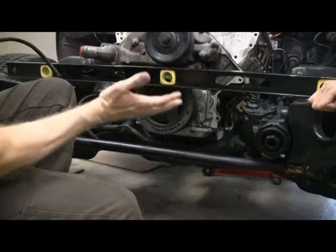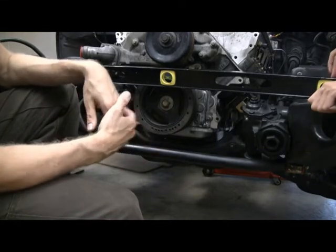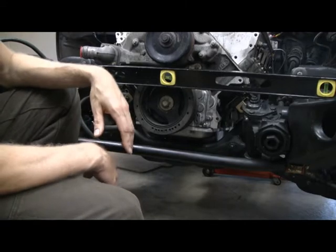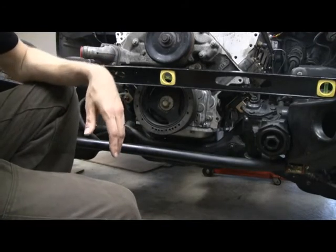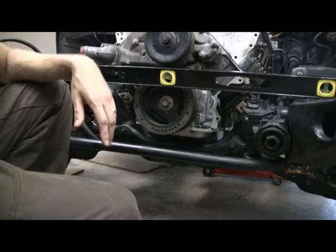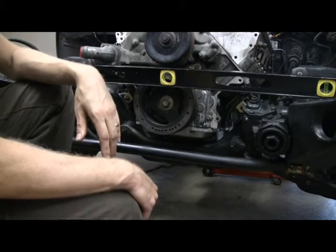I think that'll do it. So what we did was we lowered the engine by taking off the double-thick slider plate mounts, putting on just a single plate, and then using those shorter motor mounts. That seems to be the key. The only way I was able to do that is with that Holley pan because it's shallower in the front. It is really close to the crossmember — at most a quarter inch, probably closer to three-sixteenths of an inch clearance. But it clears, and this puts the driveline geometry all in the right place. I'm very happy with this.